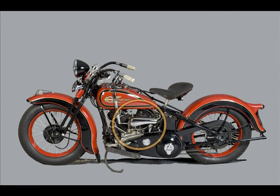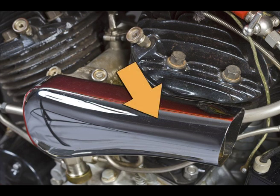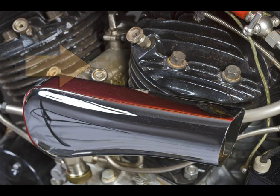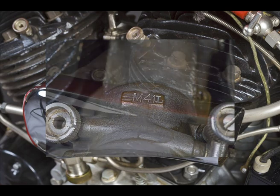We move on to the carburetor, air intake and manifold. This is the first year for the 1936 to 39 swoopy 2-piece air intake. The carburetor is a Linkert M41L, essentially 1 year, 1 model only for the 36 VLH. The finish is flat nickel.